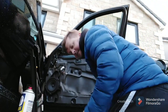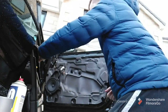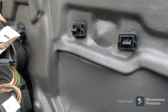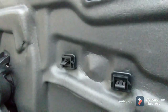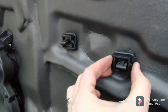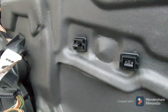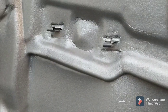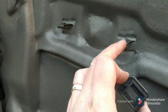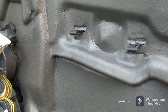I think that looks pretty good. Let's clear some space and see if we can get this door card back on without too much hassle. I was huffing and puffing a bit — I couldn't get the clips to slide back down one of these brackets. Then I realised it actually comes off and will just slide straight on. So what I'll do is take these off, press that down, put them on the door card, and the whole thing should hopefully just shove straight on. It's got a tab above and below — just get a pair of pliers, grip the end so it has a wee bit to pull out, and the whole lot should just pull out. Let's fire these back onto the door card.